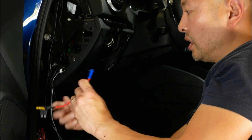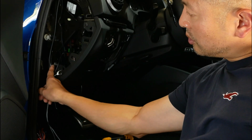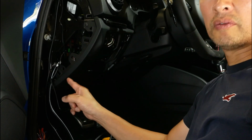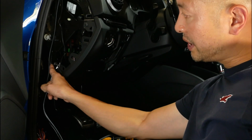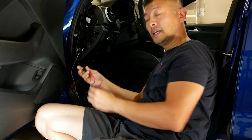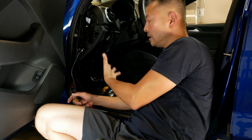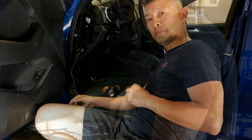This end here is going to connect to the accessory line of the power line that goes to the B124 battery pack. So I'll go ahead and connect this in, and if you could take a look where my finger is, the other end of the power line to the B124 is ground. That's going to be very crucial for you guys to find a good grounding point. So we've got grounding point, power. We'll go ahead and connect it, and we'll do our final test of the dash cam setup before we neatly put everything underneath the seat, and that will be the next step.